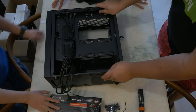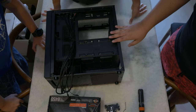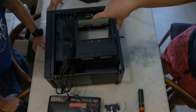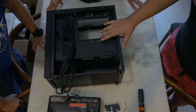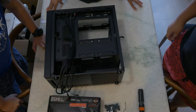The next part would be to do the motherboard — we have to unbox it, get everything ready, and then we put the CPU in, then the cooler on top of that, then the RAM, the SSD, and then we can put it in the case. We have to put in the power supply, plug everything in, and then the last part is the GPU. Best for last. All right, let's go.